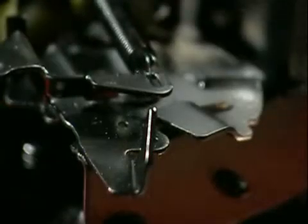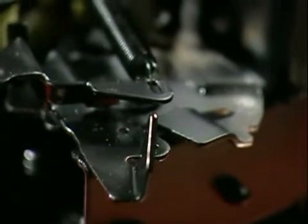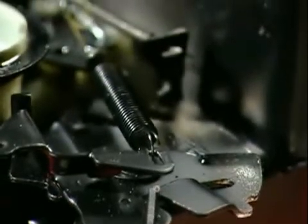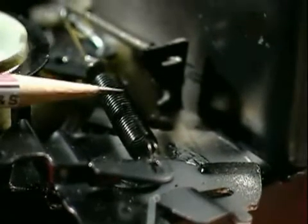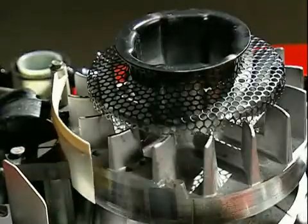The other half is the governor spring, which is also tied to the throttle plate via the linkage. The difference is that the governor spring's job is to hold the throttle plate in the open position. Since throttle plate position controls engine speed, the governed speed of the engine, then, is the throttle plate position established when air pressure from the flywheel fins balances against spring pressure from the governor spring.